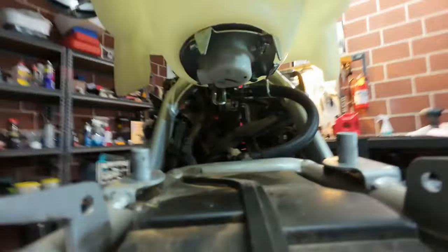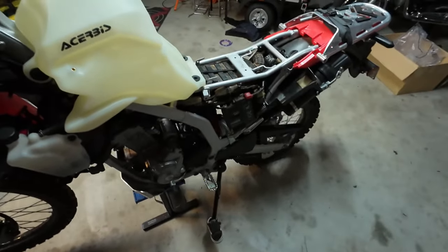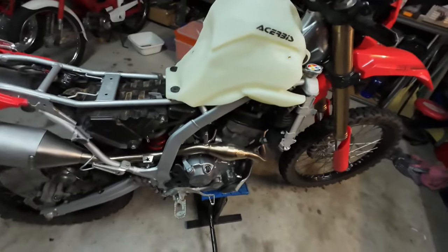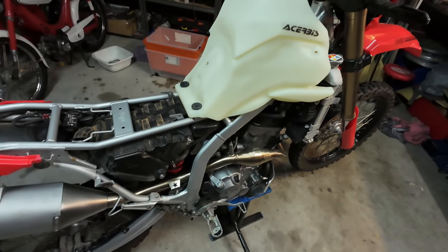There's the fuel line on top of the throttle body, and then I've got this little clip to keep it on. As regards getting that fuel hose back on and that little white clip back in to secure it — no way I could have done it with one hand. It took some wriggling; it's fairly fragile so you can't just yank it. I got a little pick in there, made sure the prongs were seated properly — they weren't previously when I was trying to film it — then kicked them into place. You've just got to fiddle with that fuel hose until it goes on. Don't lose your patience, don't force it.